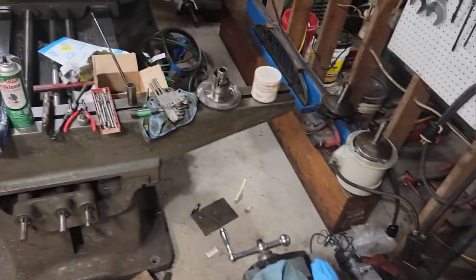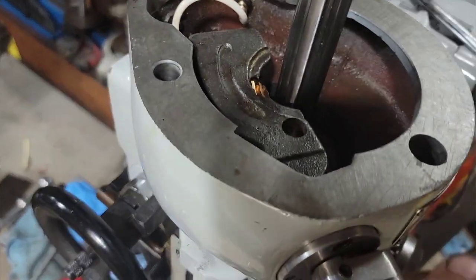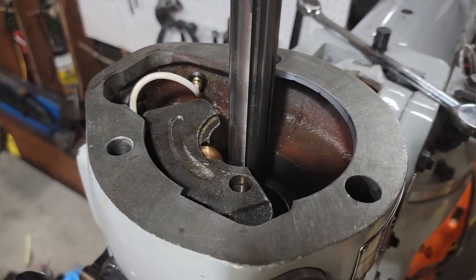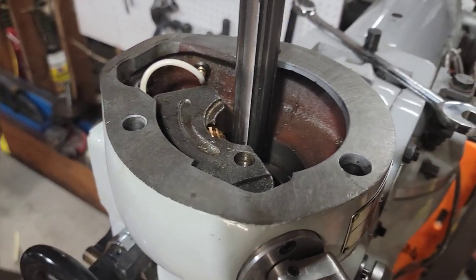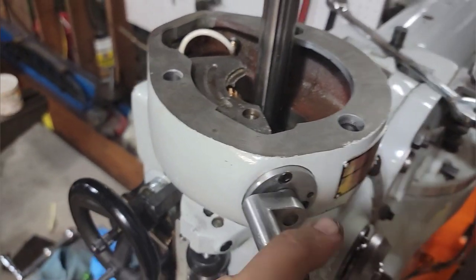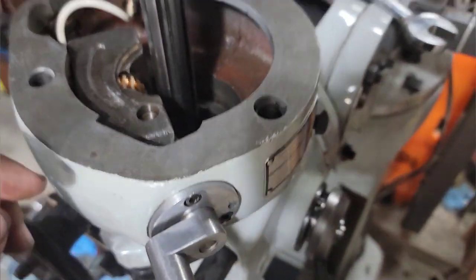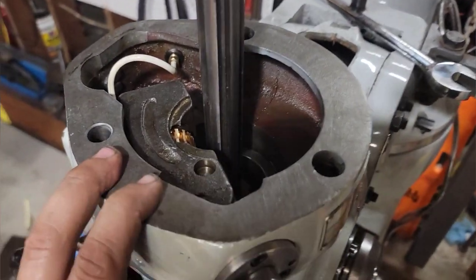That is in, and that will ride on - see that little worm gear down there? It's out, it's off. Engage your transmission - see, spins nice and free. Go reverse - spins nice and free. We'll leave this out 90% of the time because you want to save yourself the hassle of doing this. I did replace my oil line and that's all buttoned back up.